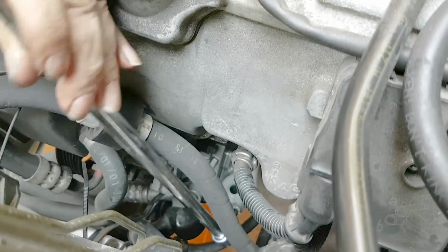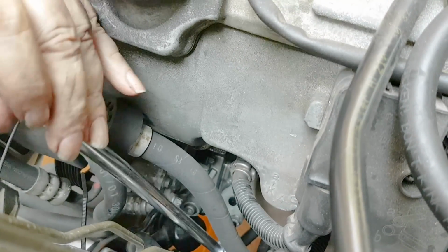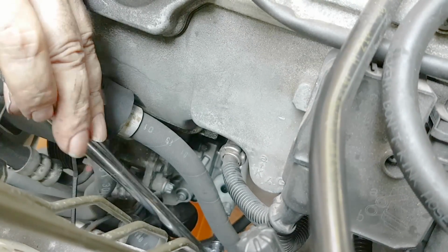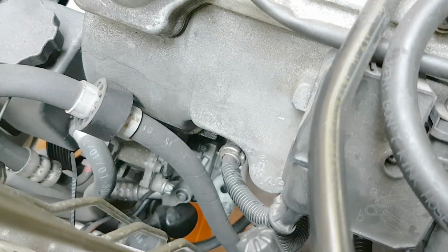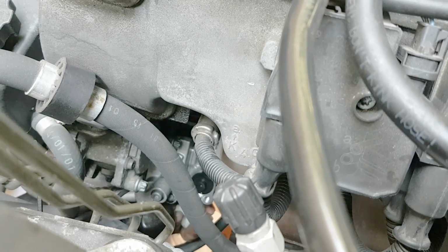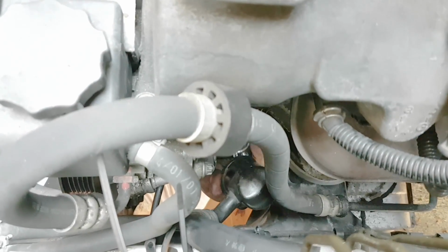As you can see here, I'm removing the plugs first, and at this point, once you install the compressor, oil will not fall out of it. You remove the plugs and then connect the lines. Like I said, first the high pressure line, then the low pressure line. And that's pretty much it.